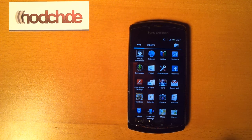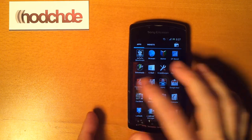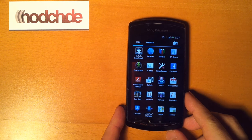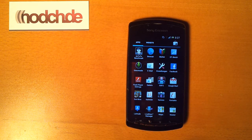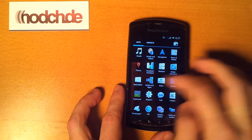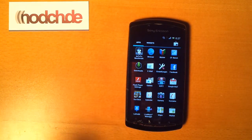This ROM, based on the leak, is a very experimental and alpha version. It's running quite nicely, but you have to expect spontaneous reboots. You can't connect via mobile networks because you can't save any APN settings. You can use it on local Wi-Fi — you can surf and browse the web, use the Google Apps. All of this is working fine, but the camera isn't working.